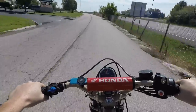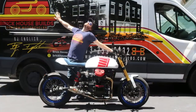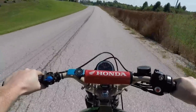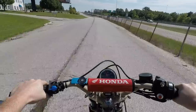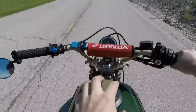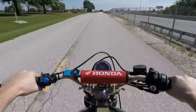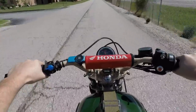Just runs really smooth. And it is kind of hilarious riding this thing back to back with Grandfather's Axe, that modified 650cc swap bike. That thing has so much more torque, and that is going to be a combination of obviously the longer stroke, bigger bore, different cam profile. I know that one also has an electric fan on it, so it's a little less instant drag on the engine. The Bakuni, it's just like, holy crap, that bike is so much faster than this one. This one's fun, it's great to ride, 500s are great, but the 650s are different.